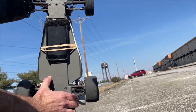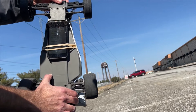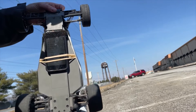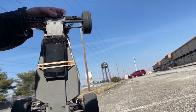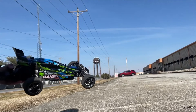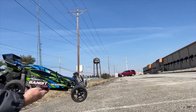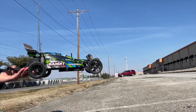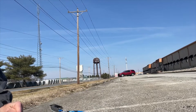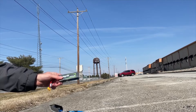That tells me with a bigger battery in my Raider, there may still be hope for 60 miles an hour. Sorry I messed this video up, but it still proves the point that even though we have the same brand battery, the same cells and everything, just a larger capacity — the larger capacity battery is faster. So this should carry over with my Raider. The voltage in theory was the same, but I guess the smaller battery's voltage is dropping more when it's under load, slowing it down a considerable amount.